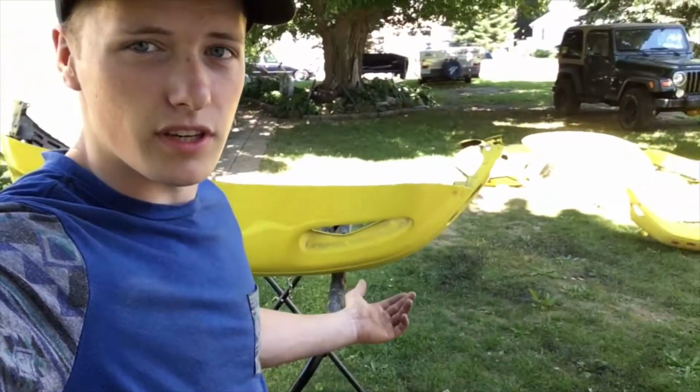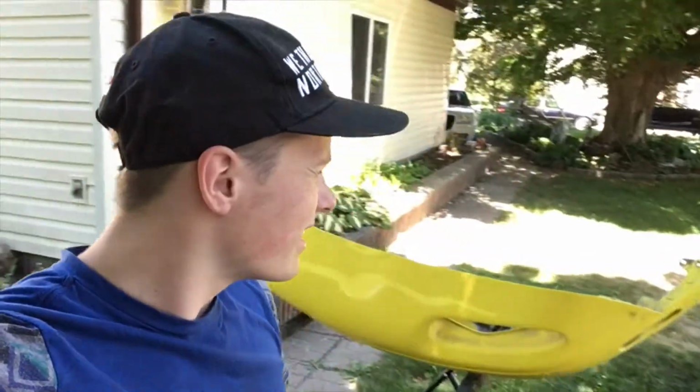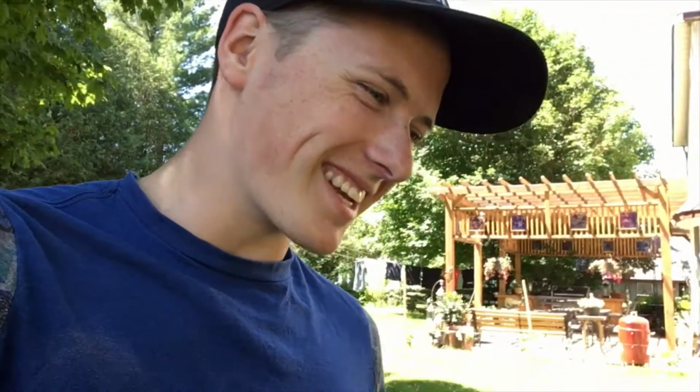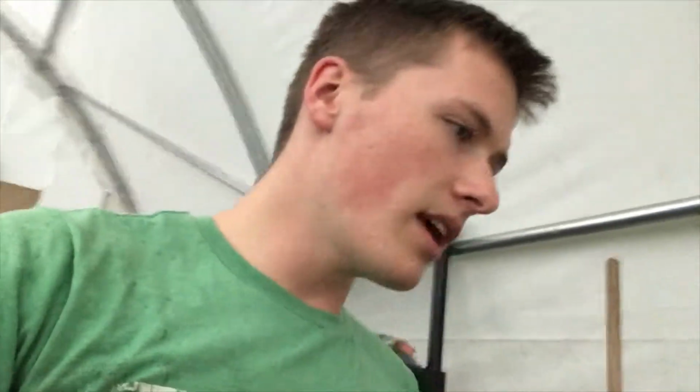Now I'm just gonna spend the rest of the day finishing up all the sanding. That's just the bumper and the hard top really. You can't see it because of the freaking sunlight, but then I got a little bit of touching up to do in the engine bay and a whole bunch of other stuff to do, but we're getting close. That's all that matters. Now I'm gonna go around to the raw materials like Bondo and metal and whatnot and just give them a little bit of primer, sand them down, and then I also got to go through with some spot putty and touch up anywhere else that might need it, and that'll be about it. And then it should be absolutely ready to be painted, so let's get to that today.